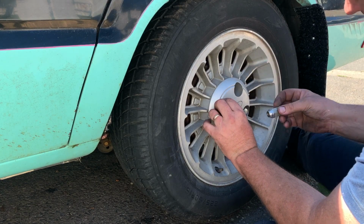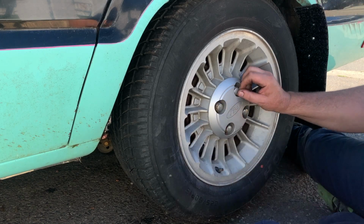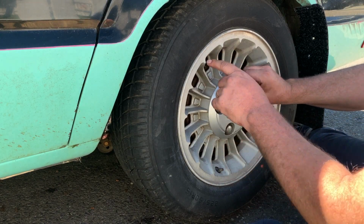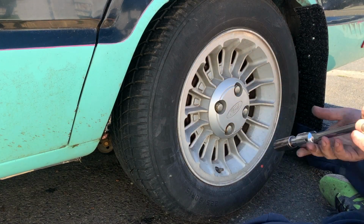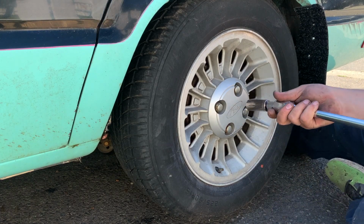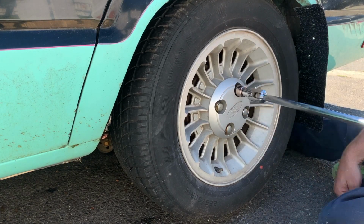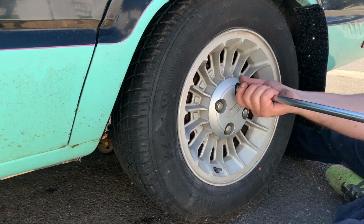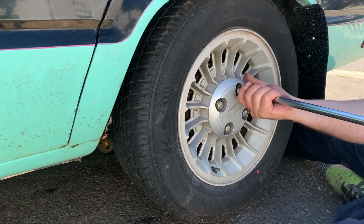The fronts are disc brakes, which everything's pretty out in the open. Any kind of leaks, I'd be able to see them. Whereas the rears, a lot of the times it just stays in the drum, so it's harder to identify. But everything's dry in these. They don't look too bad, other than maybe be ready for some shoes in the next year. Brake shoes.